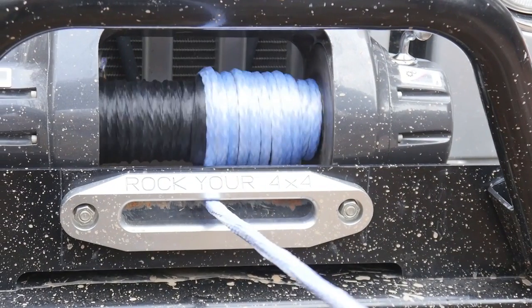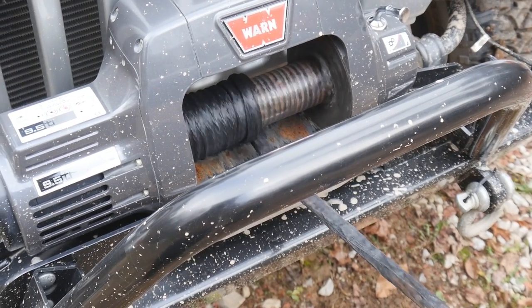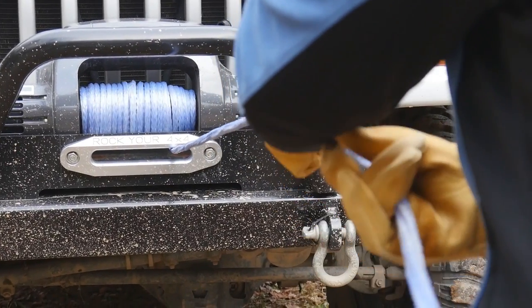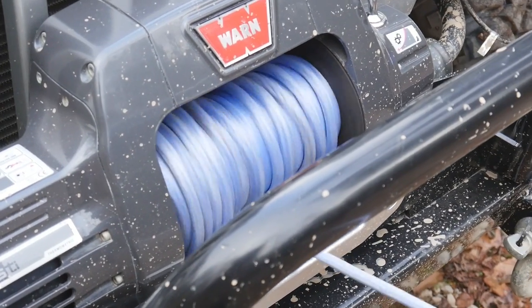Winch signals and safety tips. The winch only has the advertised pull rating on the lowest layer of cable. Always leave at least 5 to 9 wraps on the drum so the line does not come unwound from the drum. Wrap the winch line neatly on the drum to prevent binding. If a winch line is pulled down in between the layer below, it will bind and you may not be able to unspool the cable when you need it most.